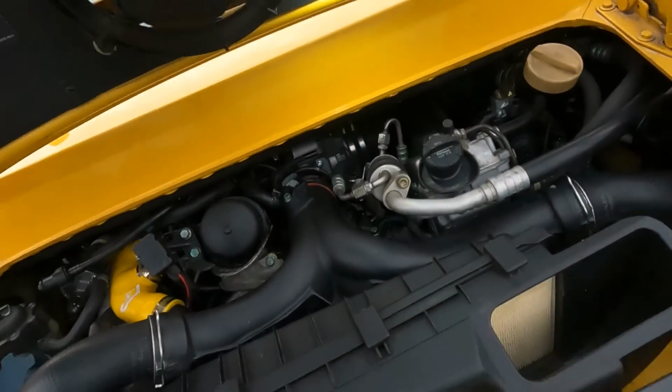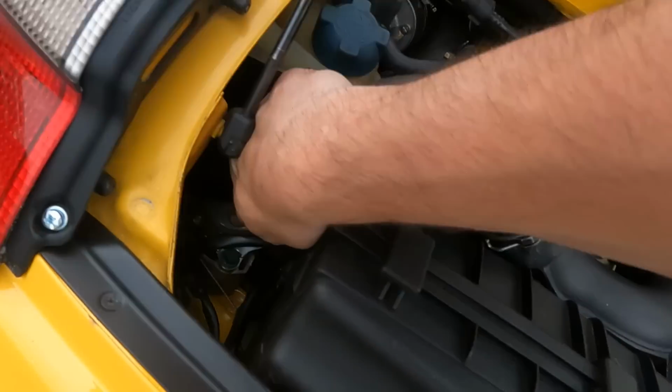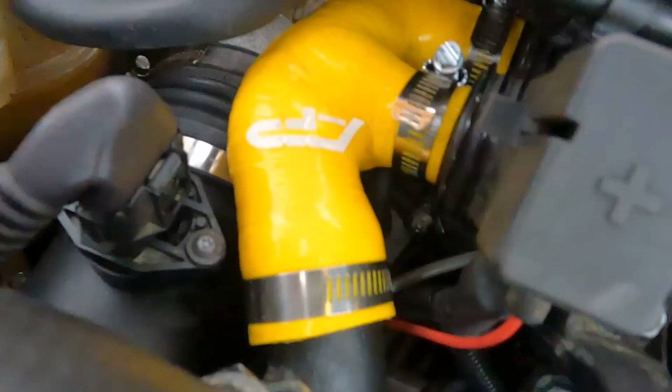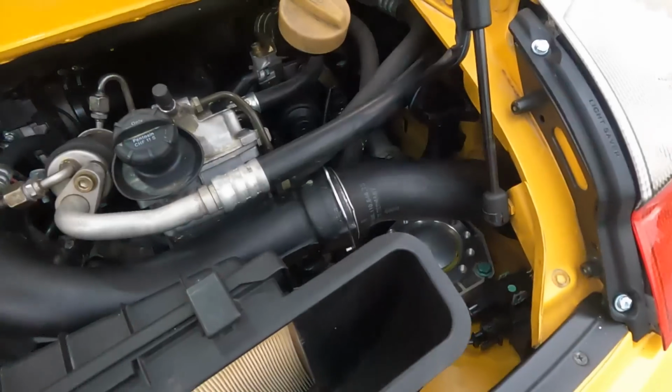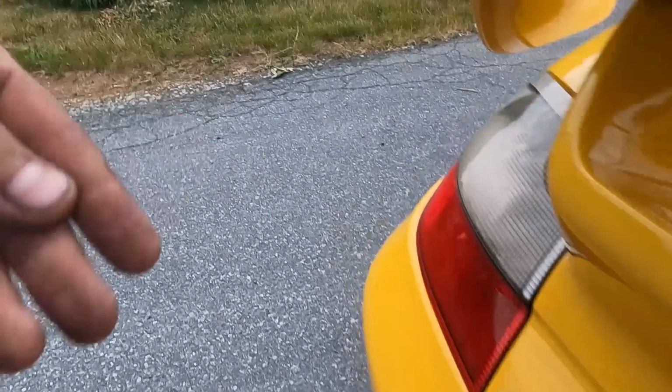At this point, I was hopeful that maybe I could see something in the engine bay that had popped off, maybe a loose intercooler pipe. Of course, that wouldn't explain the high idle. You can hear the high idle here and just how bad it is. And as much as I wiggled these intercooler pipes, deep down I knew that that wasn't going to fix the problem and I would have to dive deeper into this engine bay once again. Signs point to something still being wrong because the idle is high. Unless it's still relearning, I don't know, guys. I need a timeout from this car.